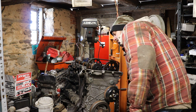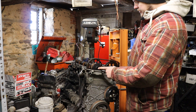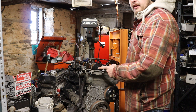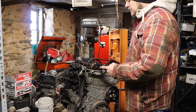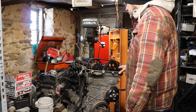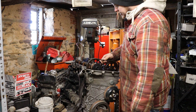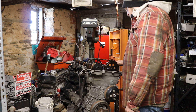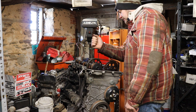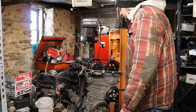Such a cute valve cover. All right, so no broken timing chain — that's a good sign. You'll also see here that we have the four-tooth reluctor wheel on the camshaft, that is for the later engines. The six cylinders also got this same reluctor wheel change in 2008. I believe this is a 2009 engine. There's a little bit of camshaft timing chain slop, not too excessive, but right off the bat I notice that the intake cam is moving around slightly, so nothing locked up there.